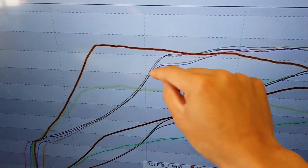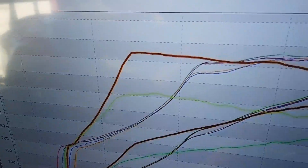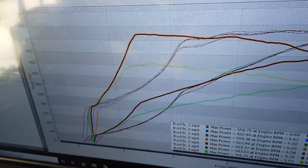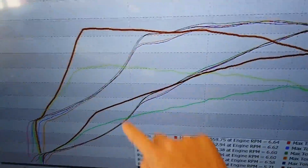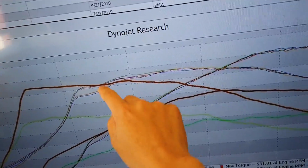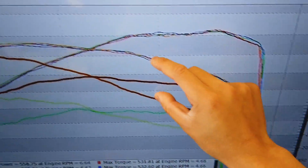So we lose a little bit here, but honestly, from 2000 to 3000 RPM, are we going to be using that on a racetrack? Most likely not. You might need it in a street driving scenario, so that might be something for you to think about. But for me, this area is what I'm looking at. So ignore everything under 3. Look at this, this is just torque, okay? Torque here is a big gain.